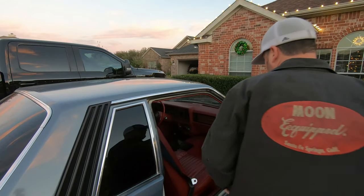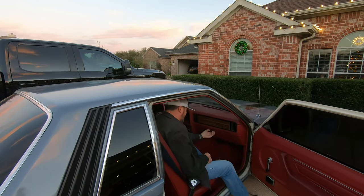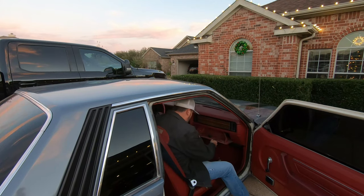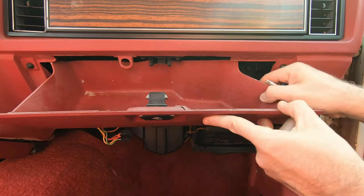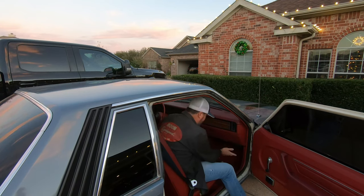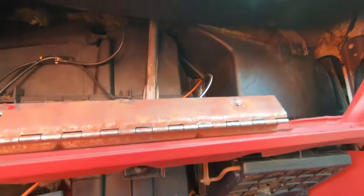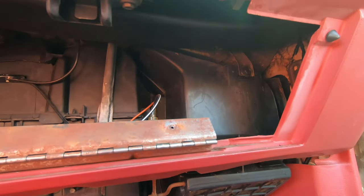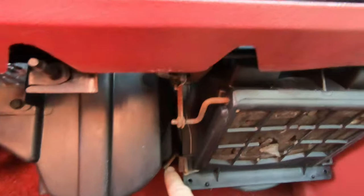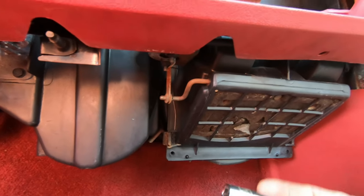The first thing you're going to do is open your glove box. On my car you take two screws off — there's one here and one here — and this is how it is on these 1979 to 1986 cars. After that it's a simple matter of finding the screws on the blower housing: there's a screw on the bottom part of the blower housing and one on top. On the HVAC box at least, you've got a bolt right here and a bolt right here, and that's going to be a 7/16th.